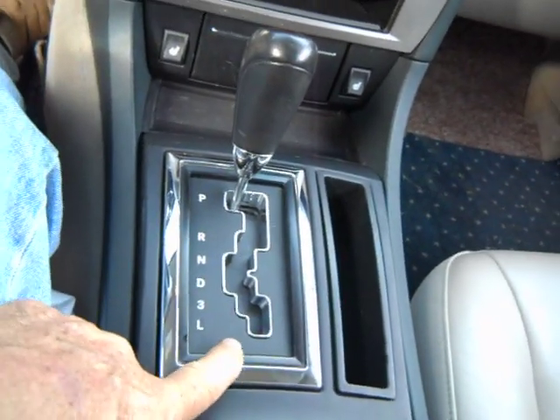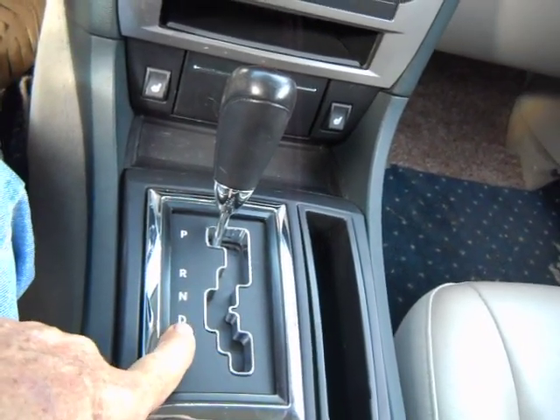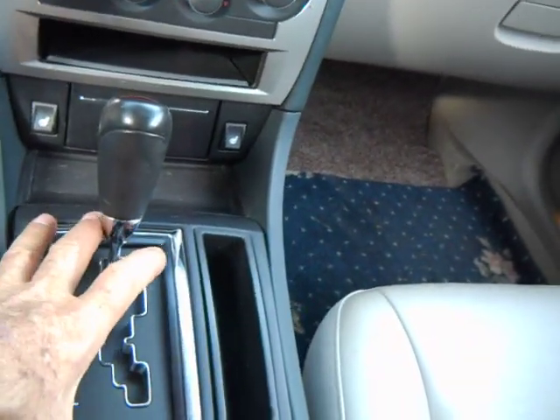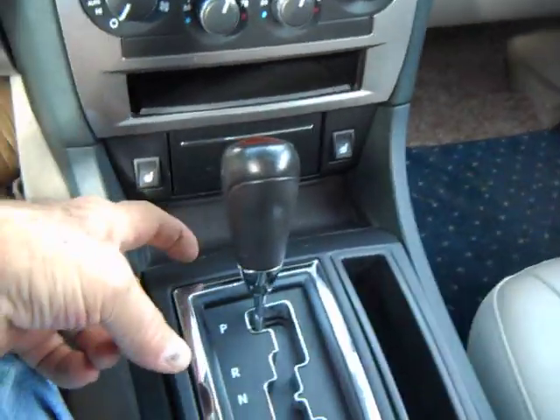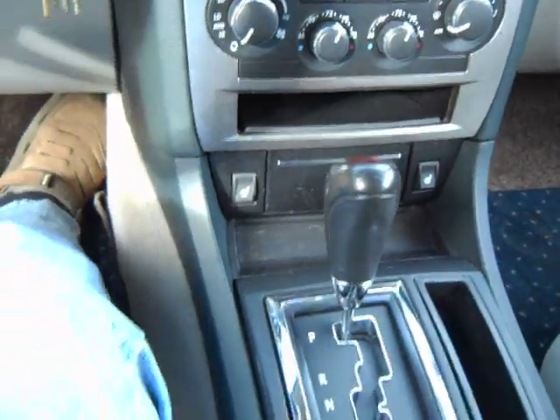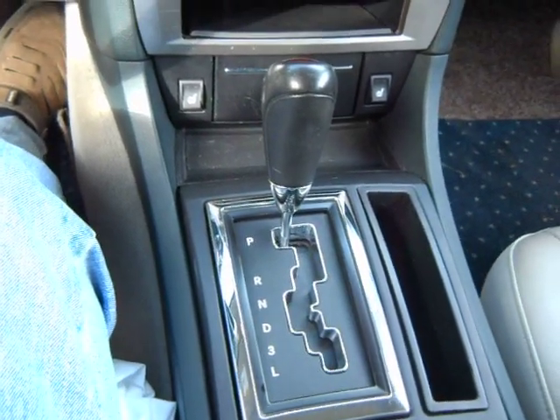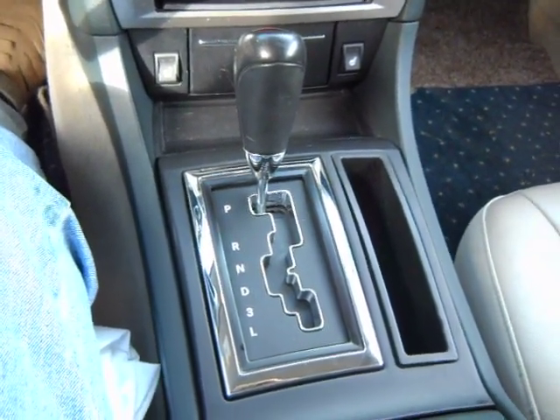Pulling off this cap was the easiest fix. Once this cap is off, you remove two screws that are behind there and there, pull this cup off, this whole piece pops off, and then you stick your finger down in there like the former video, and you can at least drive to your destination and have the car repaired when you get around to it.